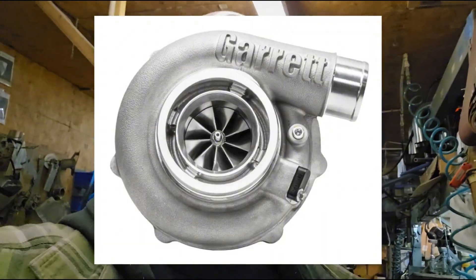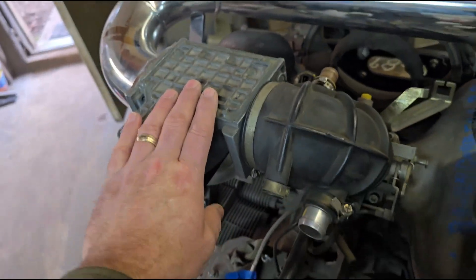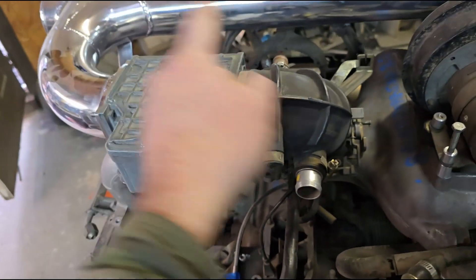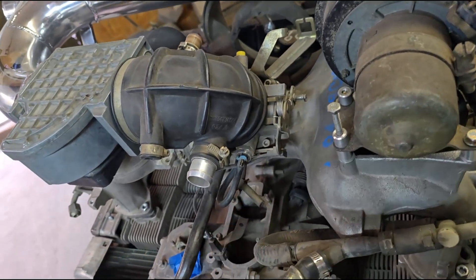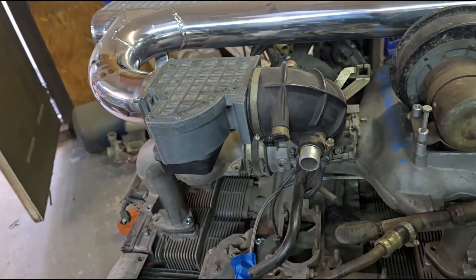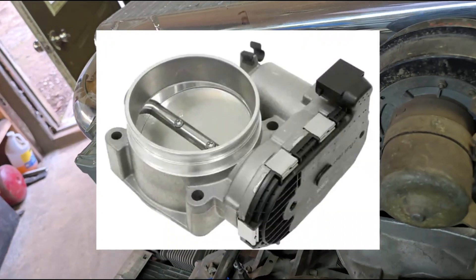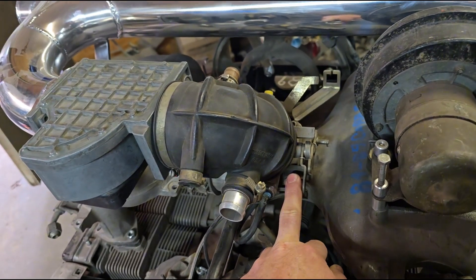The next kit we've got is a pretty fun turbo — we're using the G3770 on that one, and it's going out to a firm that's going to be Motec-ing a 3.2 Carrera. On that one, rather than plumbing into the airflow meter, we'll run it around, put a coupler or Wiggins clamp here, and plumb it directly into the throttle body. The last one we did we actually had an E-throttle on there for a Motec — we'll probably do the same thing: a 997 turbo 74mm throttle body that will actually bolt right onto the 3.2 Carrera intake with that bolt pattern.